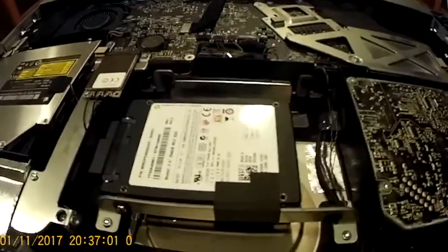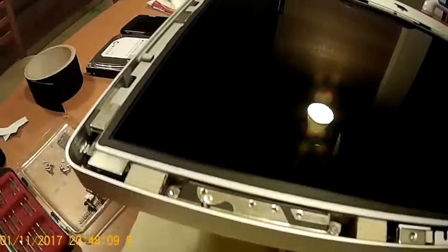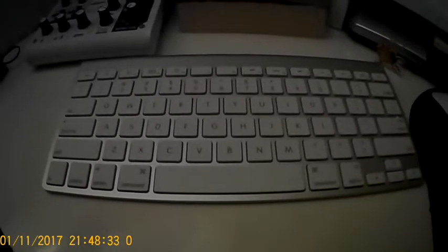As you see there is lots of space right now — maybe it's also good for the ventilation and it will be lighter. After plugging back the cables, I have gently placed the screen back in place and now I'm going to screw back the screws. After booting your iMac, don't forget to reset the PRAM by pressing Option, Command, P, and R altogether after powering up.